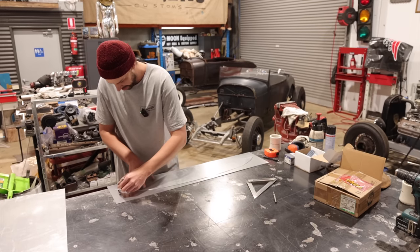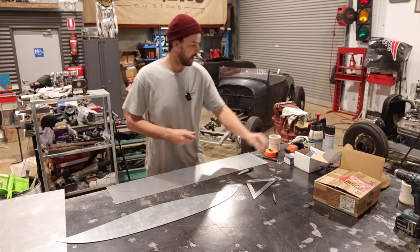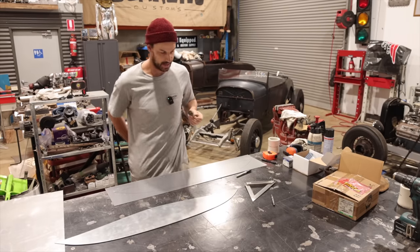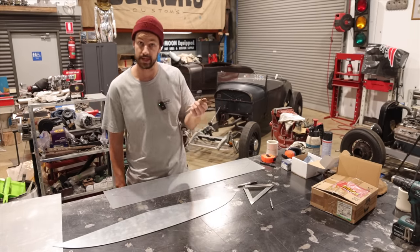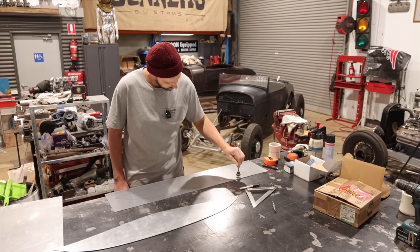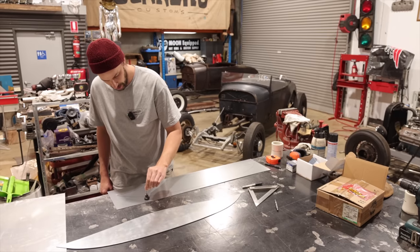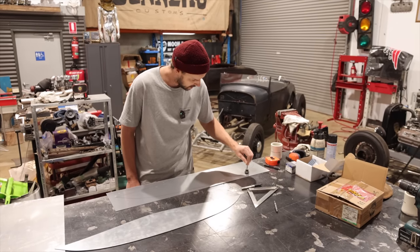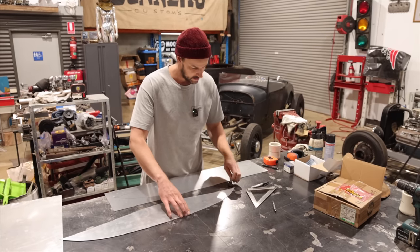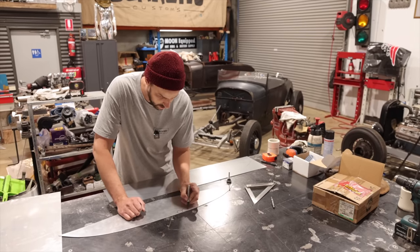for our dash. So now when we're coming down with our little twirly super fancy high-tech device that we made for the drill press that allows us to get the engine turned texture, when we come across this, we can then just start here, run it across, and as soon as we run off the line, stop. Then we can go back, get close to the line, run a few off and go across and stop. Because the worst thing is to have them start like this. You want them to run off the edge.